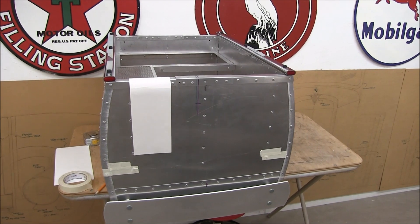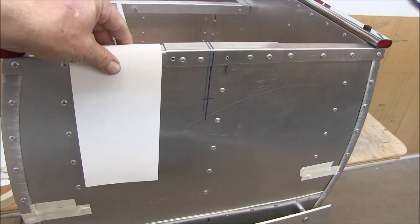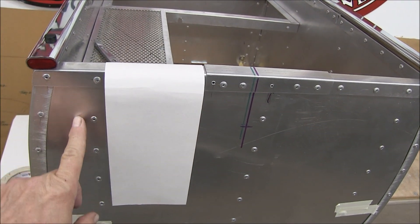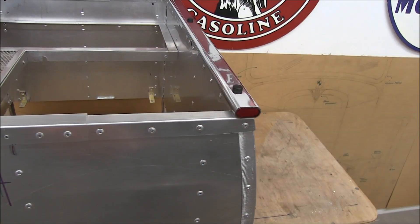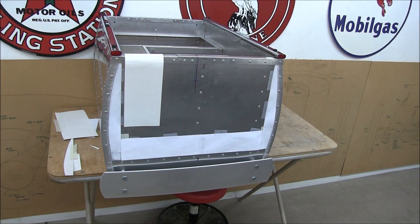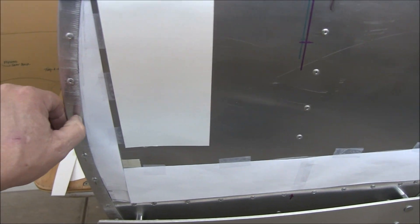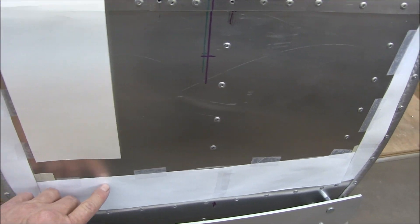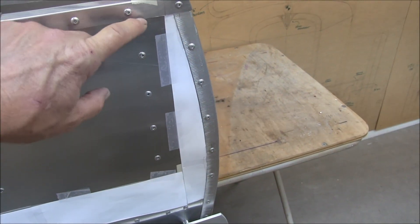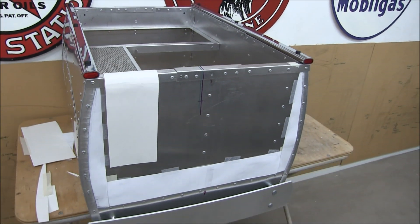I thought I would try to come up with what would appear to be a tailgate — it'd be non-functioning, I just wanted to make it look like there's something there. I thought maybe I'd do a rolled edge, plant on an aluminum panel, and try to create some kind of seam to make it look like there's a tailgate. This will be 40-thousandths, same thickness as this corner trim, and I'll leave an eighth-inch gap. I'll make a panel with a rolled edge, remove this piece, and then when I paint it I can paint that reveal black or dark gray to make it look like there's a gap.